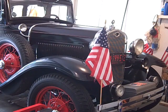Now, as far as the brakes go, the Model A is designed to be a rear skid system. Modern cars are front skid. The front wheels lock before the back do. But on a Model A, it was designed to skid the rear wheels first, and then the front wheels contribute to the braking. Check for slop in the rear brake lever bushing.